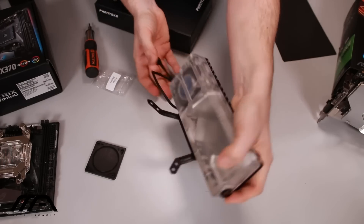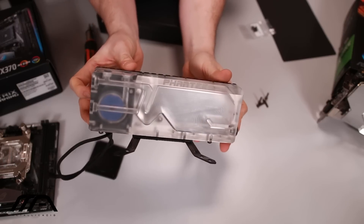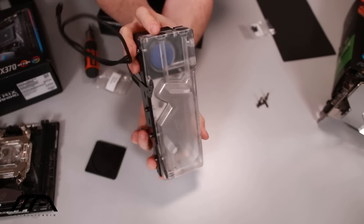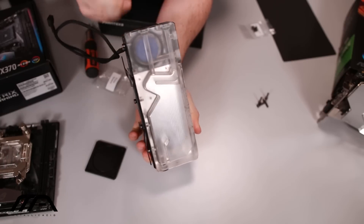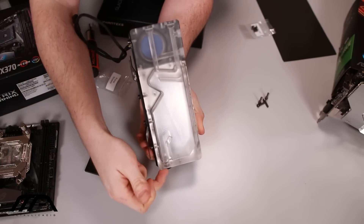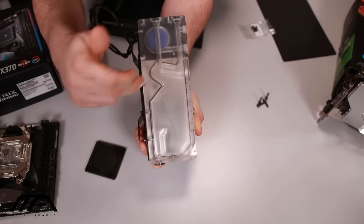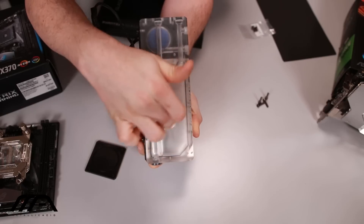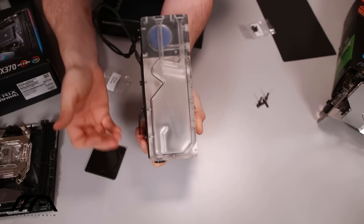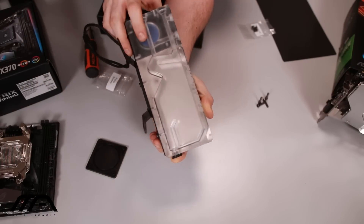So, possible configurations: you can have this reservoir in any orientation that you want — this way, standing upright, or this orientation — just as long as you don't have the pump in the upward position, because then you won't have a good feed for the water. The only port for the coolant to be pumped out of is down here, and if you have a low water level with the pump facing up, an air pocket could form and you could potentially kill your pump with a bad flow of coolant.